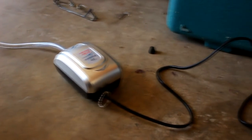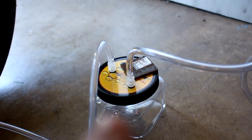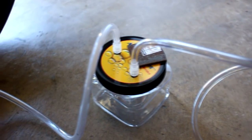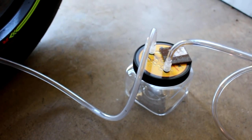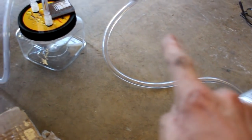At this point I've got the pump hooked up to the container. One hose goes to the bleeder screw, the other goes to the pump and connects to the blue port — make sure you push that hose in really good, you don't want it leaking. I stuck something on top of the container to keep it from moving. Also, when you get this thing pumping, don't let it go above three-quarters full — you don't want brake fluid making its way into the pump. The wrench is 8 millimeters.